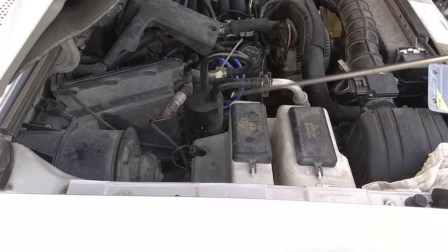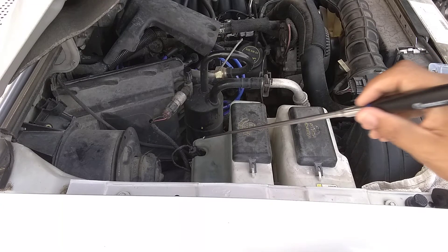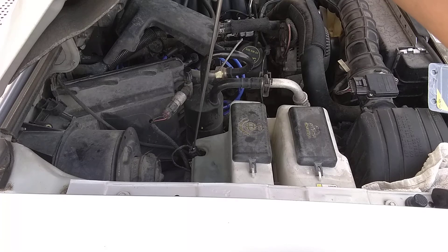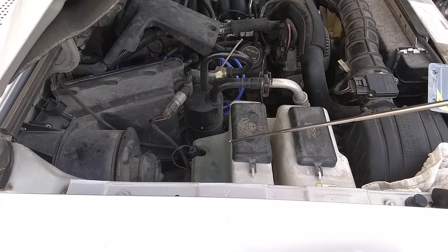This is the reservoir unit attached to the radiator coolant reservoir — they're two separate units but share one housing. Coolant is on the front side of the engine bay, and the washer fluid reservoir is on the other side. Your washer pump is right here, and here's the pigtail that gives the pump power to operate.